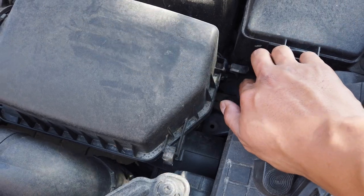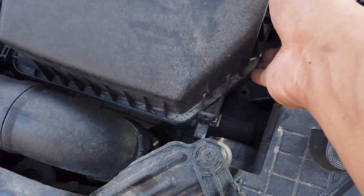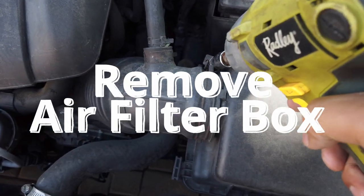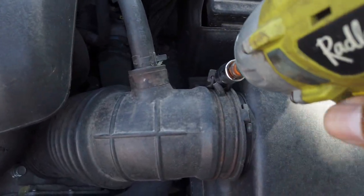But I know what's wrong because the timing chain's loose. So I picked a cam sensor for $100. It might fix it, but because I know the timing chain's loose, it may not fix it.